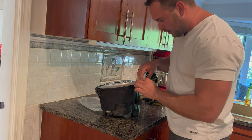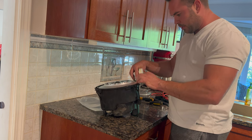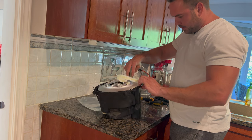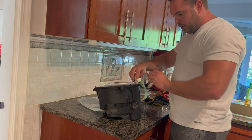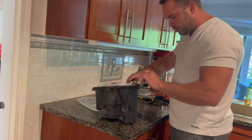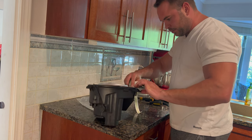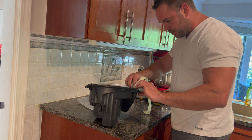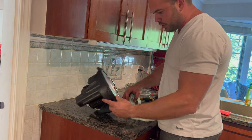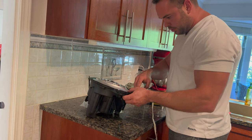And I think then what we're supposed to do is we put it back in the oven, we warm it up, and then we put our lens on, and that way the glue is nice and soft and the lens will go on properly, because we want this to be sealed as well as possible, because we don't want any leaks obviously. Try not to drop your headlight off the counter when you're doing this.